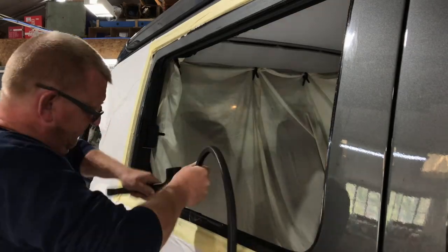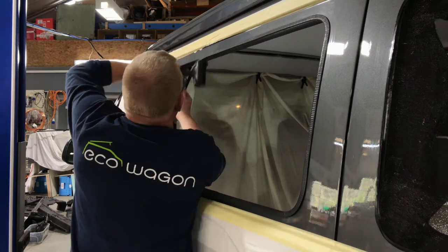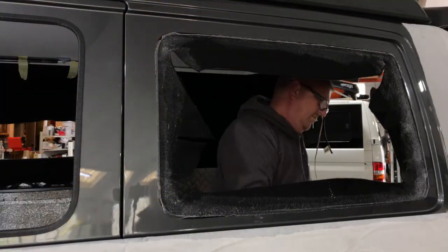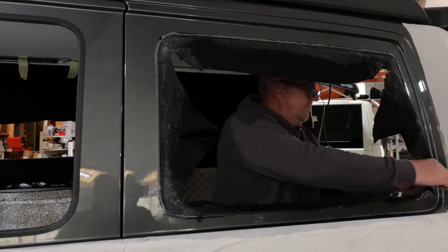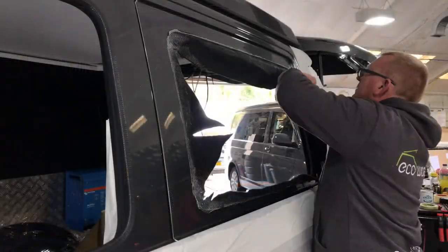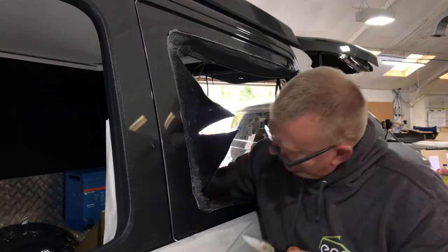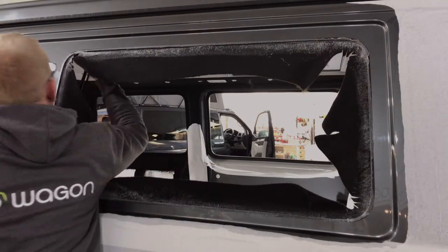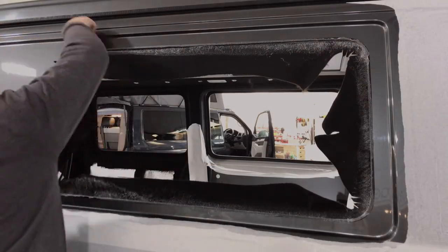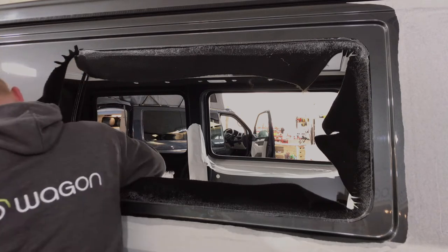And that's Craig having to do sort of a retro thing because of my carpeting. There's a knock-on edge that goes on the sliding door only, and that's because you don't carpet the sliding door. If you do, it usually looks hideous - so traditionally we don't do that. You put on that knock-on edge, which makes a super neat edge. And once the window is on, it looks like it came from the factory - it makes a very nice overlap over the cut edges.